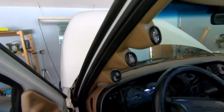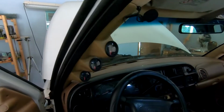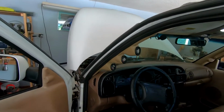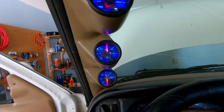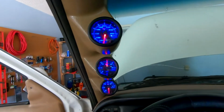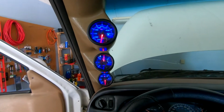Okay, well, that would explain why our fuel pressure was down. It rolls out like 30 psi now. We got to turn that down real quick. I guess that battery's been a drain on the system for a little while now then. All right, let's see how she looks now. That's a little better. Okay. Yeah, 20 is about where I want it. And then, real ideally like 17, 18, but it's good enough.